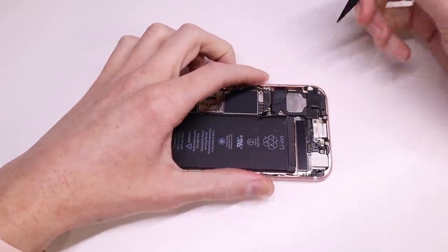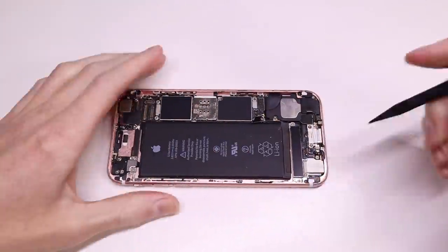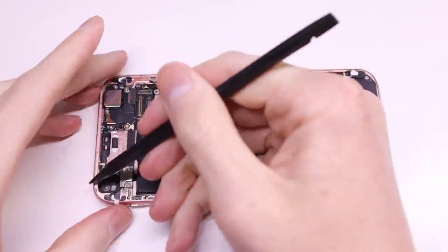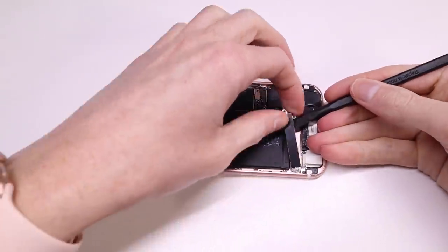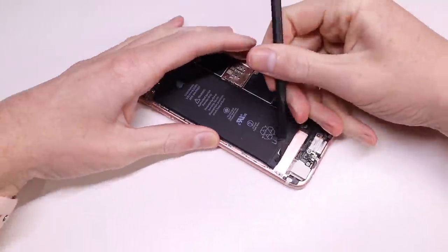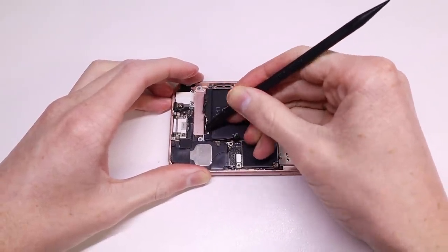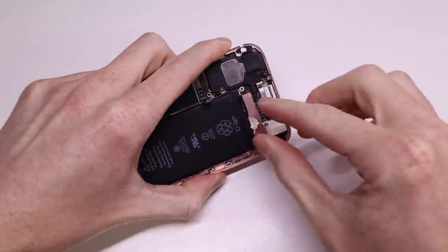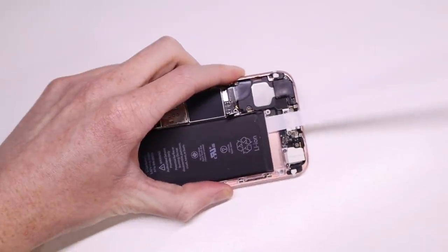I started removing the remaining water gasket now to save time later. Using a spudger I can scrape along and remove the dirt, grime, and anything else so when I apply the new seal it seals in properly and makes good contact with the phone. Next I can remove the vibrate motor, which will give a little more clearance to the battery adhesive tabs — making those tabs much easier to remove without breaking them. Breaking these tabs is a big deal because you'd need to pry out the battery, which deforms it and poses a risk of the battery becoming inflamed.